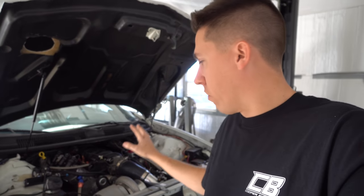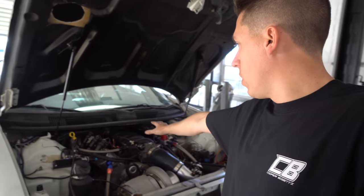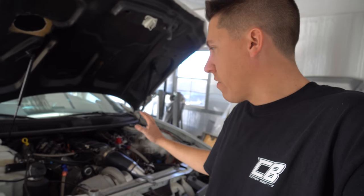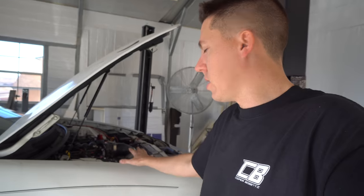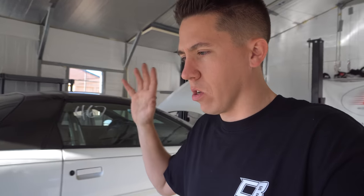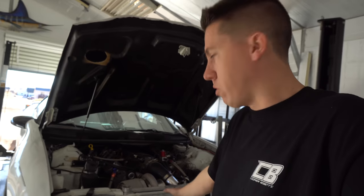Number nine is no intercooler in the car. After playing with the Buick and multiple other cars that I've tuned, not having an intercooler I'm losing a ton of efficiency. I need to get either a big air-to-air or air-to-water intercooler — I'd love to do something like a Sheer Fab air-to-water intake if it fits under the glass once the cowl's cut, or a front-mounted intercooler. With C16 we saw 85-degree intake temps even after a half mile. C16 is expensive — about $100 for five gallons — but it's simplified, clean, and consistent. I don't recommend running pump E85 on any combo like this because pump E is just dirty.